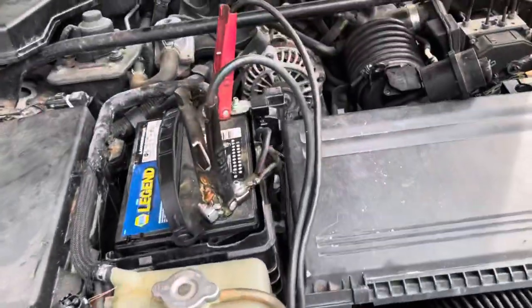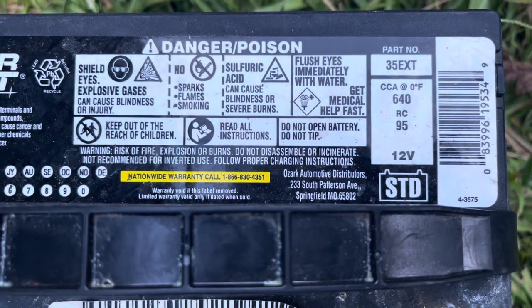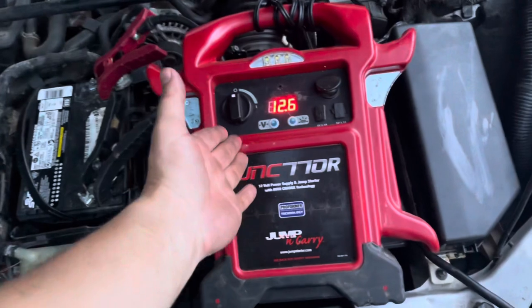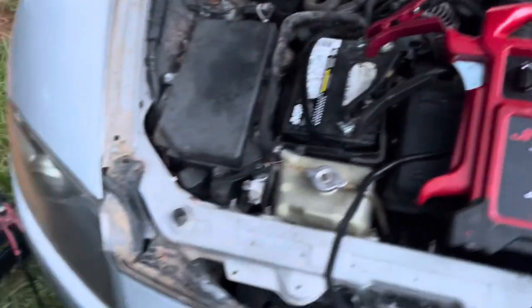As you can see, it is spinning so much faster. The very first time I tried cranking it over after freeing the pulley, it spun really fast, and after doing a couple of those tries I walked around and found the battery was being charged just like a normal two-to-six amp charge cycle. I am using the proper battery size — about 750 to 800 cold cranking amps, which is exactly what's recommended for this size Mazda RX-8 engine.